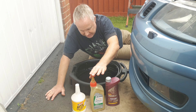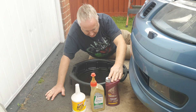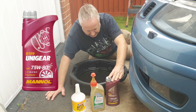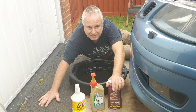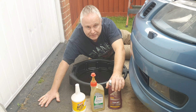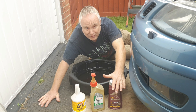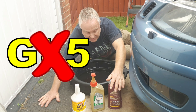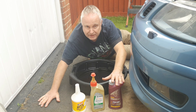I've done two fills with the Castrol now, but this time I'm going for Manol Unigear, which is a 75W80. The specified fill is a 75W85 GL4. Whatever else you do, do not put GL5 in this gearbox. I'll report how I get on with this in the comments.